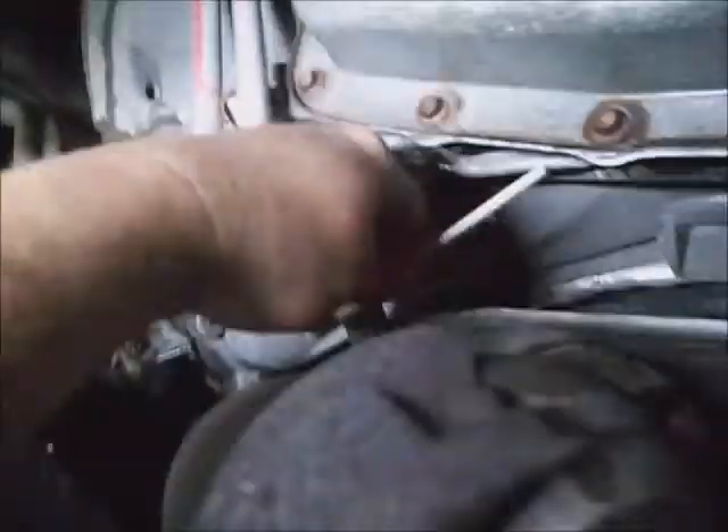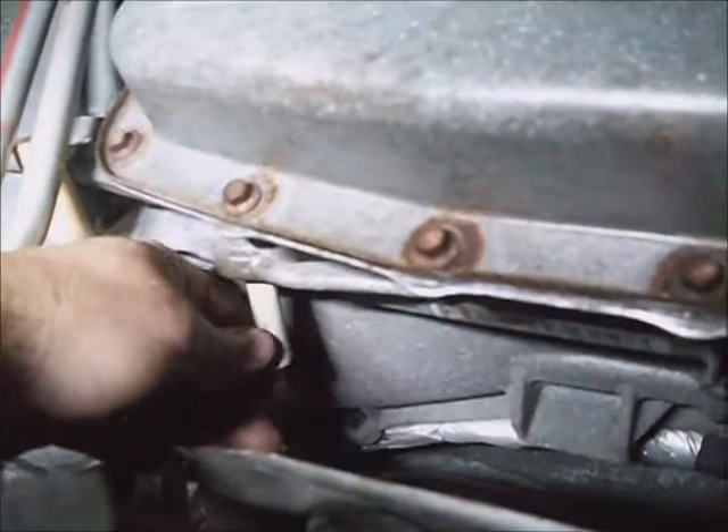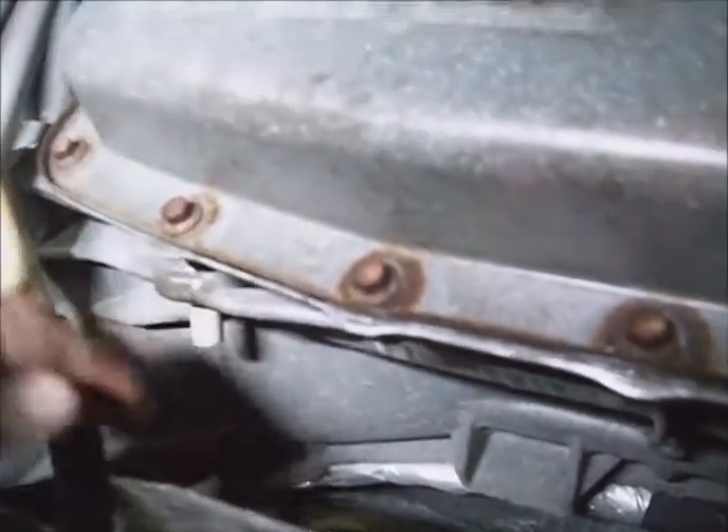It's running. Take whatever precautions you want about blocking the wheels. Stick the dipstick in there and see where we're at after about 30 seconds of running — I haven't shifted it through the gears or anything. The exhaust is going to get hot fast. The stick drops all the way down so there's just about 3 quarters of an inch sticking out. I'm not reading anything — it's dry — so I'm going to go ahead and stick another quart in it.